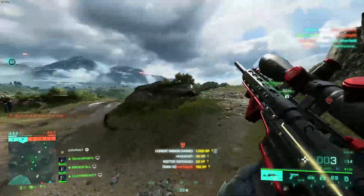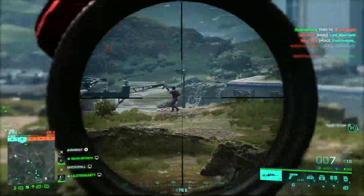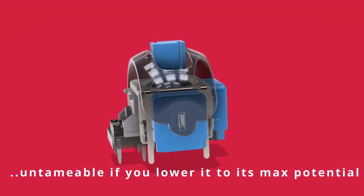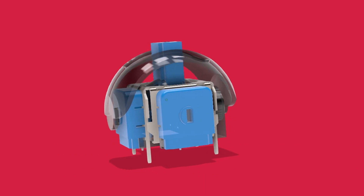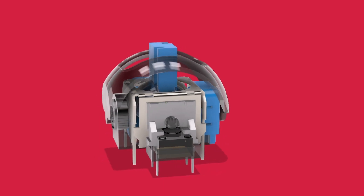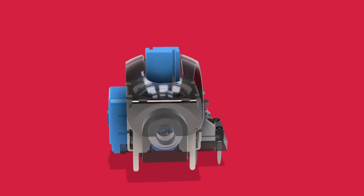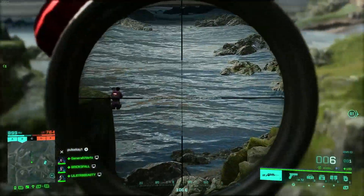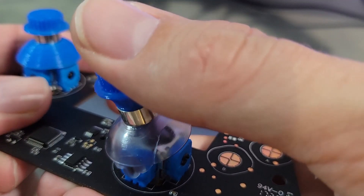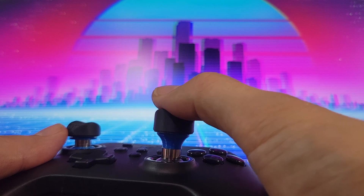What that does is remove a little bit of stability from the dead zone area. As soon as you rest your thumb on it, your aim is drifting around — it's almost untameable how small this dead zone is. What I believe I need to do is create the tension much higher than it is right now. Right now the tension sort of matches a normal analog stick, but I believe I need double or even triple the tension, which should also create more accuracy. Higher tension with no friction should let you pinpoint the exact angle of deflection you want much easier and remove a lot of the shakes happening in your hand.